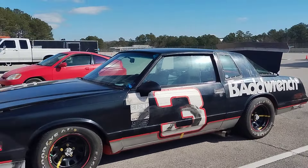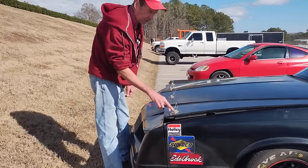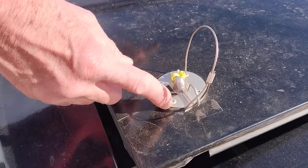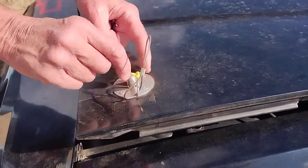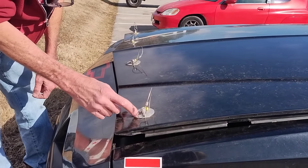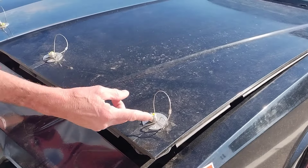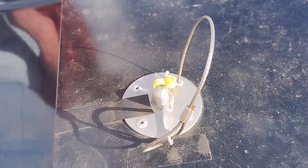For the hood pins, I didn't want to cut the original hood. I went to Lowe's, got half-inch aluminum stock and cut them down, then made a plate with rivets — cut the rivets flush and epoxied it on, so they're not functional but serve the look. I made these clips out of the aluminum you buy for chain-link fence at Lowe's and bent them to shape like carabiners — barely any weight at all.